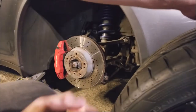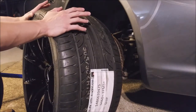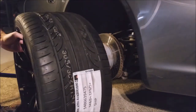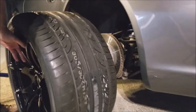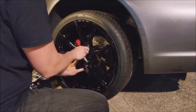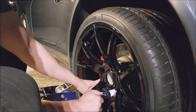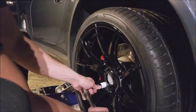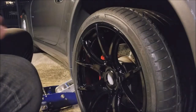We're putting the new wheel on now — I don't have to use spacers anymore. They claim this should be the right offset already. Moment of truth — don't forget to pull off the plastic film. The torque spec for these wheels is 96 foot-pounds; we'll do that after.